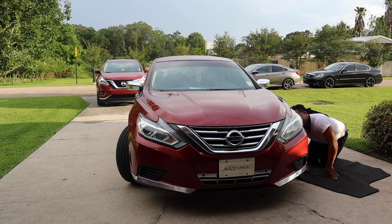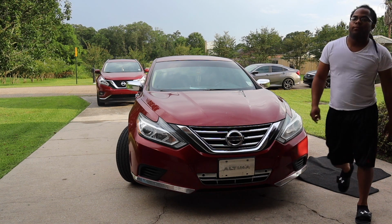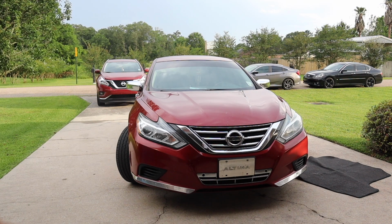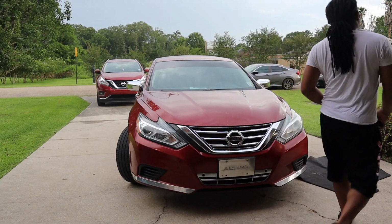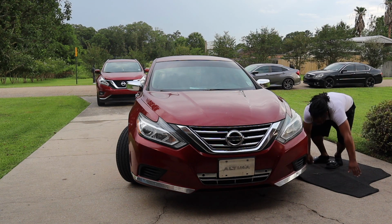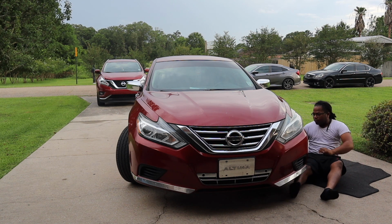On these cars, you don't have to drop the bumper. You could just get right behind that tire, turn that wheel, and take one little clip out, and you could get enough room to wiggle that headlight bulb right out there, and you could snap your new one right on. It still works. You're gonna hurt your hand doing it. It's probably gonna be easier if you just take the bumper off, at least as far as hurting your hand goes. But yeah, it still works.